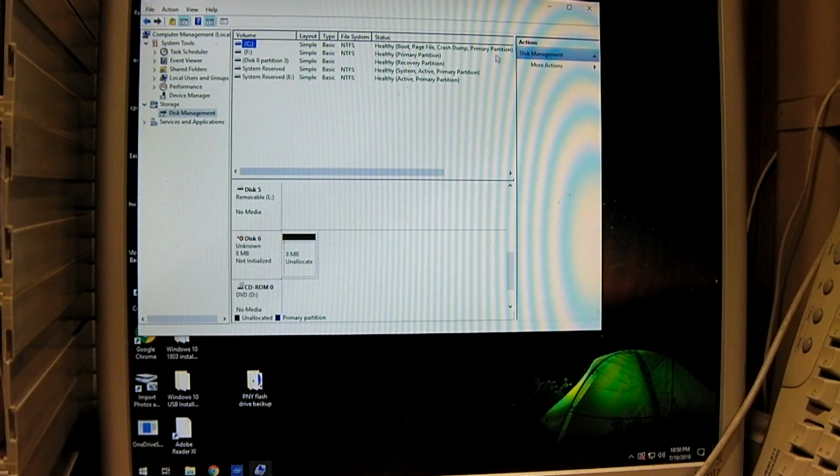The only option, I think, if your drive has suffered from this, is to send it off to a data recovery company, and it's going to probably cost you dearly. I've looked and looked, and from what I researched online, there's no real easy way to recover your data off the drive. If you don't care about your data and just want the drive to work again, you can flash the newer firmware on it, and that will get the drive back up and running, but you most likely won't be able to recover your data off of it at that point.